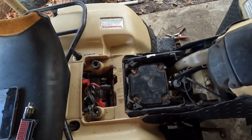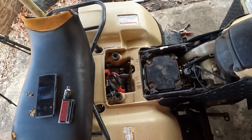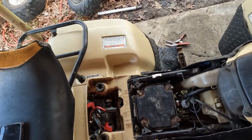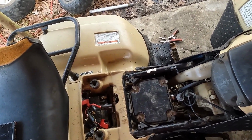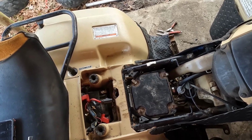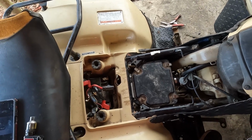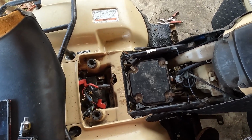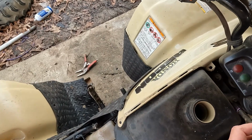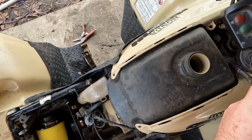2009 Honda Recon. We're fixing to do the top end on it today. We've got to take off the gas tank. We've got to take off the air cleaner, carburetor, and the little heat cover that's underneath the gas tank to be able to get to it. We've got to take the 2 bolts out that hold the gas tank on. It looks like a 10mm.